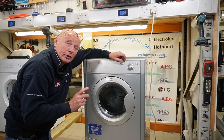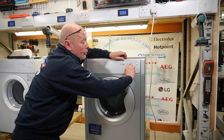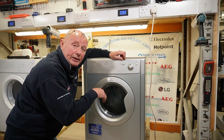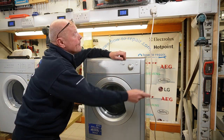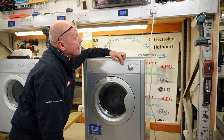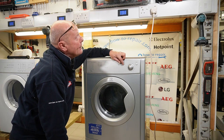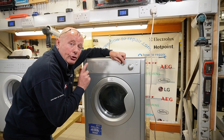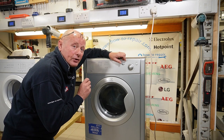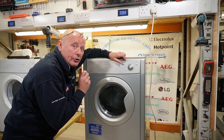When testing the machine, I also found out that when turning the machine on, you've got two heat settings, a high and a low heat setting. And we should be drawing about 9 amp, but we're only drawing 5.8 amp. And when I press the high or the low button, the amperage doesn't change. So I suspect we also have a problem with the heating system, and we'll need to actually do an inspection on that.